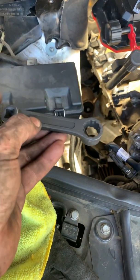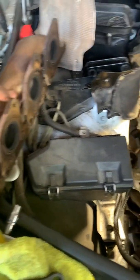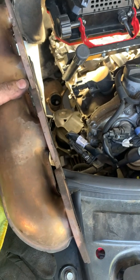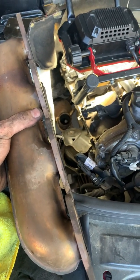The problem is this tool is not really universal — I did not get enough clearance because of the header. So what I ended up doing was removing the header. For all you DIYers out there, I found this to be the lesser of two evils. I didn't really want to mess with the suspension or the alignment.